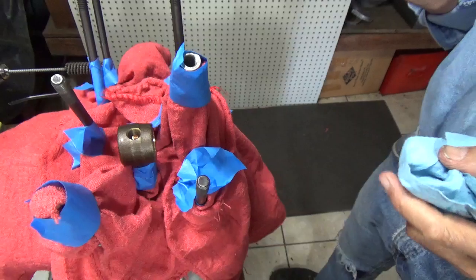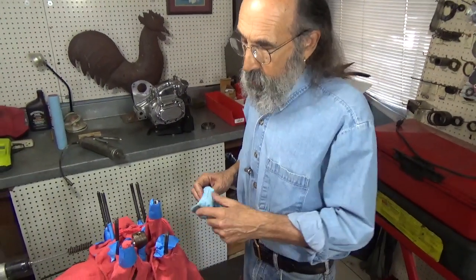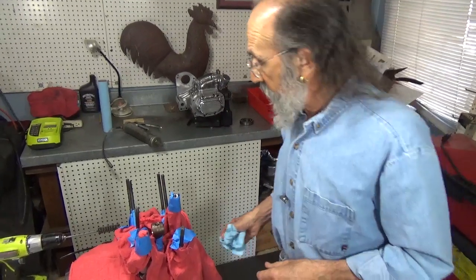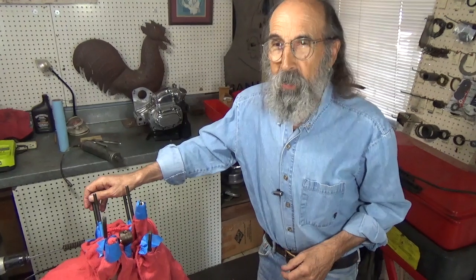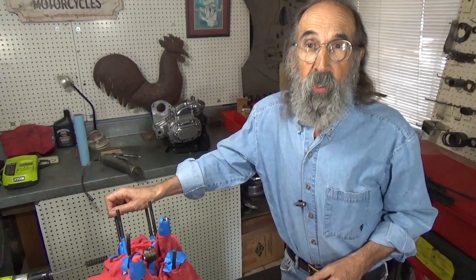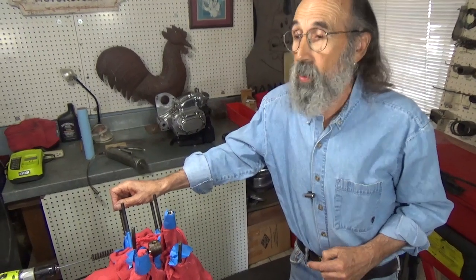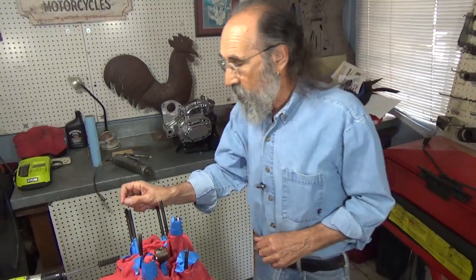To get it absolutely finished for that perfect hand fit — when you push it through, it should be a soft hand press to push that wrist pin through that bushing. I've already done the rear one and I'm doing the front one now. I just wanted to show how it's done. By all means, if you're enjoying our videos, please subscribe. Don't forget to click on the little bell so you'll be notified when we have a new video. There's a swap meet this weekend in Torrance, California at El Camino College on Saturday and I will be there. Until then, see you out on the road.